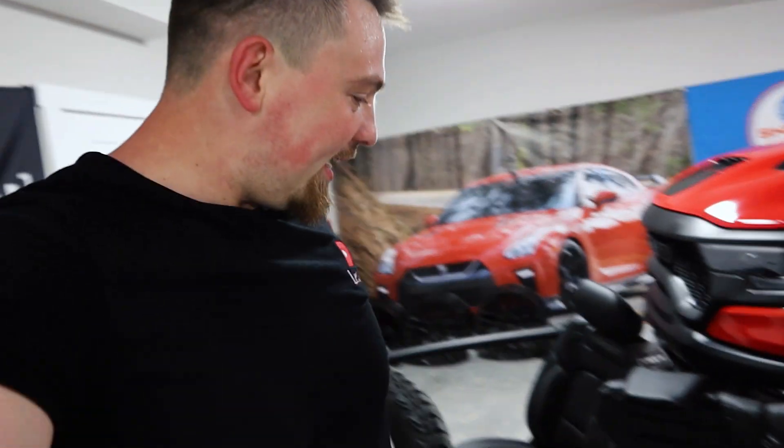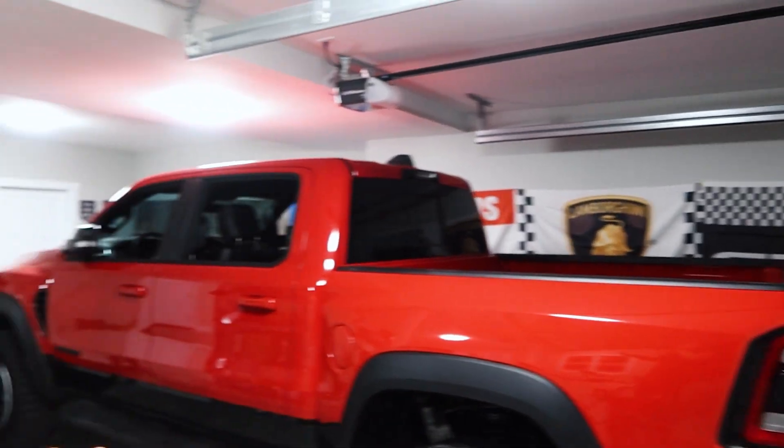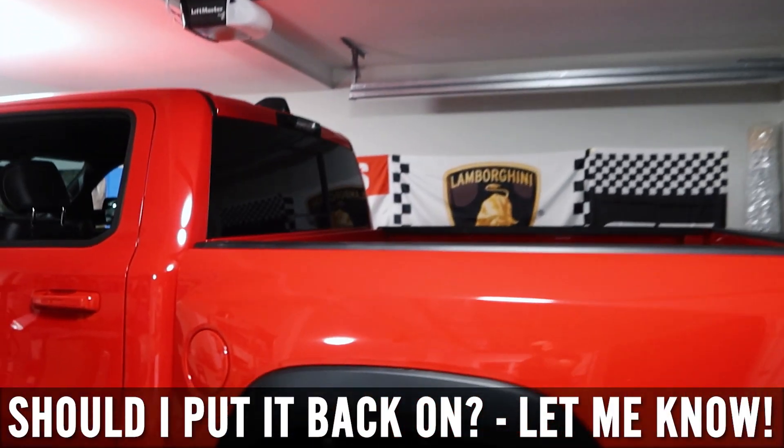400 pounds - I promise you we're going to notice that at the track. On top of that I had car seats and a lot of other stuff in that truck. I've always wanted to try weight reduction mods like this and see what it does. I'm excited to see what happens at the track. These seats are so comfortable and just look at that massive front end - it's like a TRX staring you in the face. It was a little bit of work but it'll be easier the second time. All you need is a 10 millimeter and an 18 millimeter for the back bolts. Just remember to pull the strings on the rear seats. Do you guys think I should put the RAM bar back on, or do you like the look without it? Comment below!